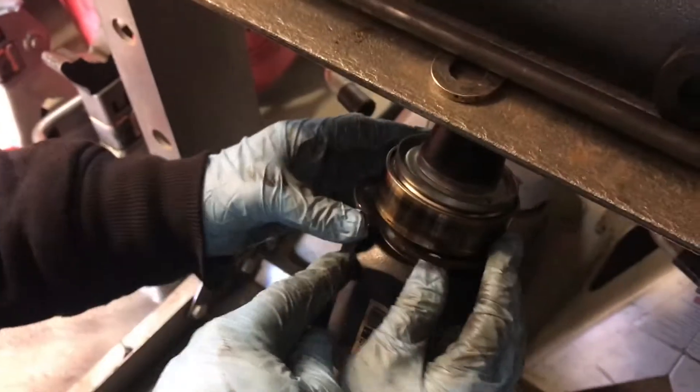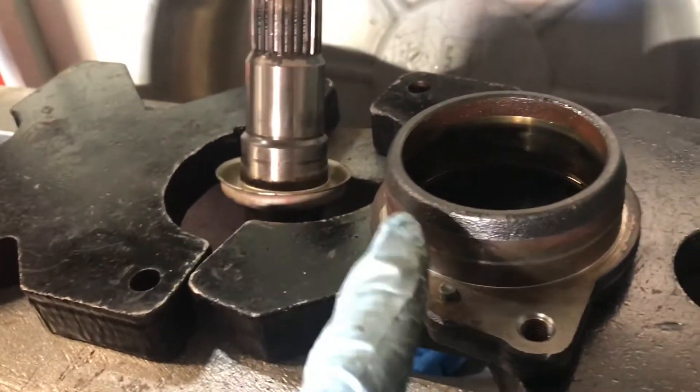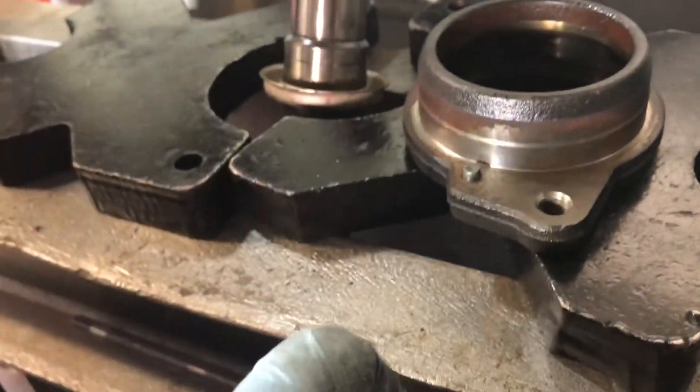Now see how this is — don't lose that snap ring. Right inside this part of the area there's a snap ring, right here, and it's on the inner part of the axle. Did not even see it. It looked like you just unbolted this part of it, but you don't. There's actually a snap ring hidden — it's really tricky to get to. You have to push down one side, get what we call a scribe, put it behind it, and pull it on out.